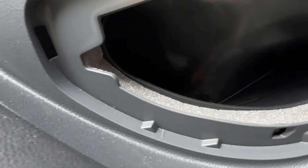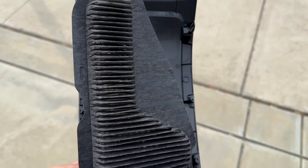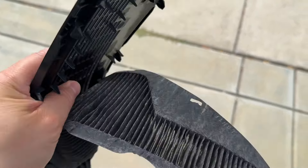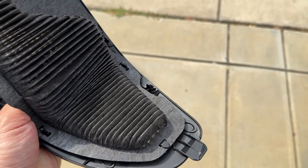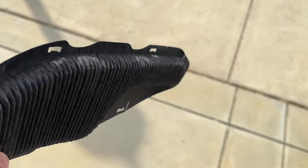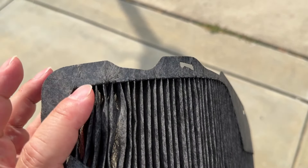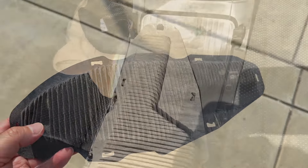You can see there's a big opening — that's where the battery lives, on the second row of the vehicle. You'll want to inspect the filter. If it's dirty, clean it — blow the air out or use a vacuum — or just replace it if it's really too dirty. Make sure you inspect it carefully. I'd say you probably want to do it every six months or so. Don't wait a year to do it, and definitely don't block the vents to the hybrid battery.